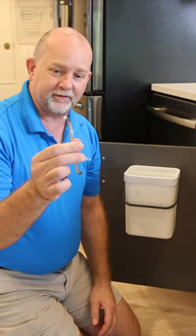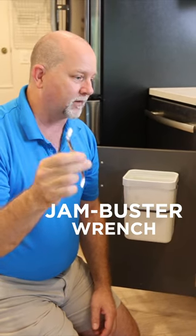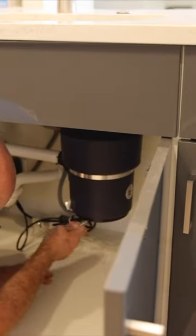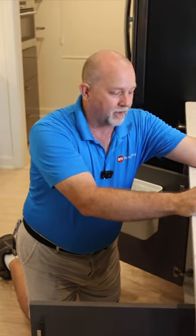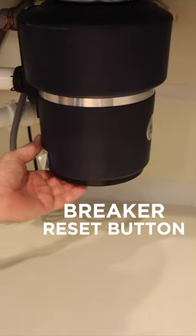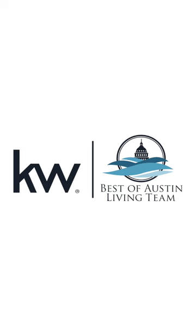So what you've got to do is get yourself one of these — oftentimes they come with this — but if you don't have yours, you can just grab any old Allen wrench that fits. You just insert that in there, wiggle it back and forth, and once you get it moving again, find that foreign object and remove it. Afterwards, reach back under, reset that little breaker, push that button right back in. Then it should take off again for you and you'll be back in business.